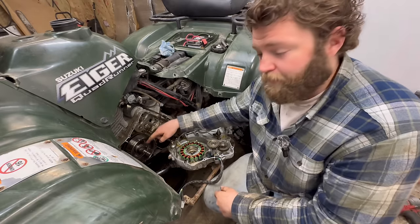Get our coil line on there - almost back together. Now we're going to remove our oil filter. The oil in there almost looks like it's got water. I'd be concerned if this was a liquid-cooled machine - I'd think possibly a seal or the head gasket had gone. But this is oil cooled; there's no antifreeze in it at all, so it must have just taken on water at one point. It might actually be condensation - I've seen condensation build up so much in some of these things that it looks like it took on water.